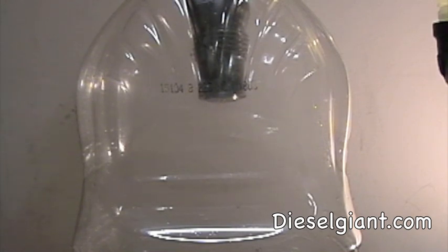This is a really good safety point also, is that you absolutely never ever want to have any of the spray that comes out of the nozzle get anywhere near you, because it can pierce your skin. You can get skin and blood poisoning and you can die from it.